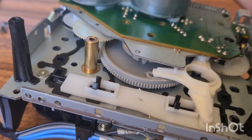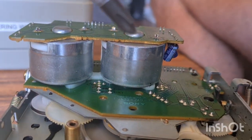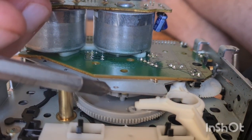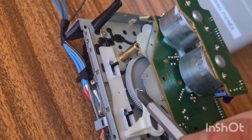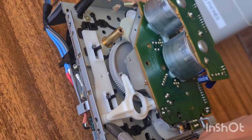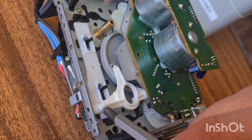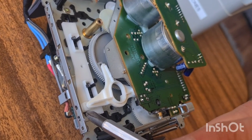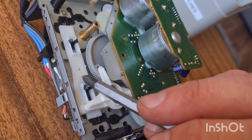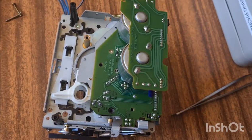So we're all lined up. If you look inside here — very difficult to do — you can see that cam inside the switch, and this arm sitting in the mode select wheel properly. This white bit moves up and down and allows the tape to run inside — it's more of a safety feature. So when your head comes up — all controlled by that big mode select wheel — when your head comes up to play the tape, this also pops up and allows the reel and the take-up reel to turn your tape.